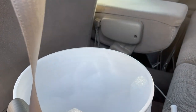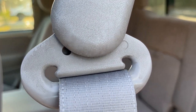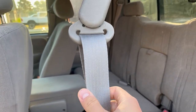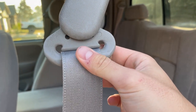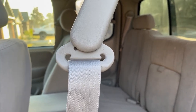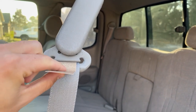While that's soaking, I'm going to focus my attention on the slit up here. It's not super tight, but you can imagine if the seatbelt itself is really stiff and not flexible, when it tries to come back in it just gets caught up on the top side and doesn't want to retract - a lot more friction. So I just cut some 120-grit sandpaper and I'm going to slide it in and just go back and forth a few times.